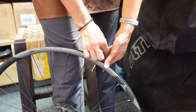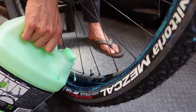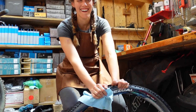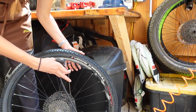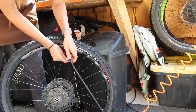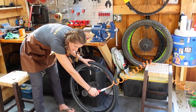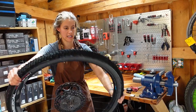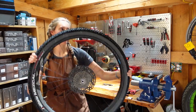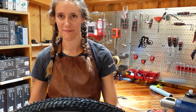Get the little rubber widget on there and screw on your valve stem — these things have names. Then figure out which way the tire goes. We always take the valve core out because then more air goes in at once, which increases your chances of seating the tire. Bang! That's the world's most satisfying sound. Then do the sealant dance — rotate the wheel so the sealant goes everywhere as opposed to sitting in the bottom.